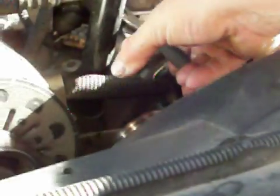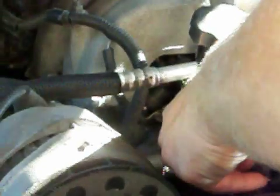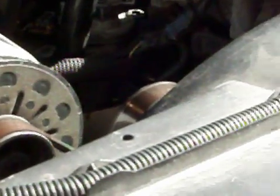Normally this would be just a few minute job, but everything's a little slower because it's so hot. So it's just a bolt with a nut. There's basically a stud with a nut on it that holds the thermostat housing down, and then the stud that extends past that, the only point in that is to put these other two nuts on to hold those grounding wires.